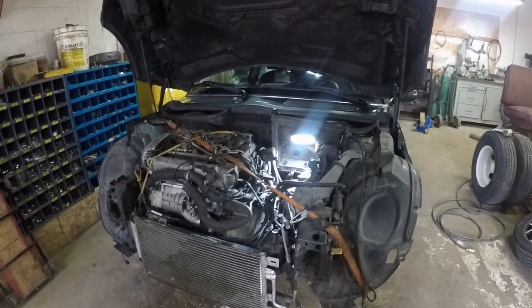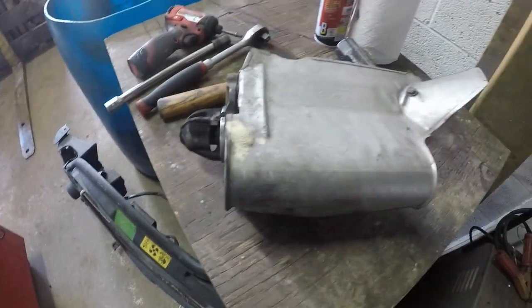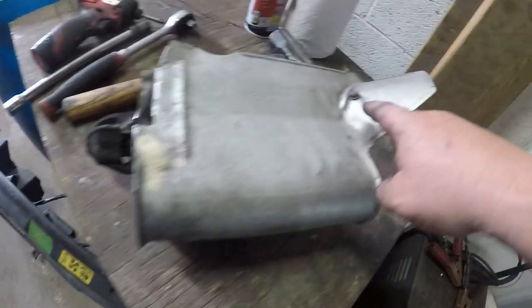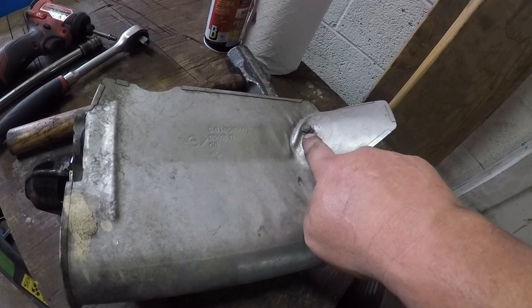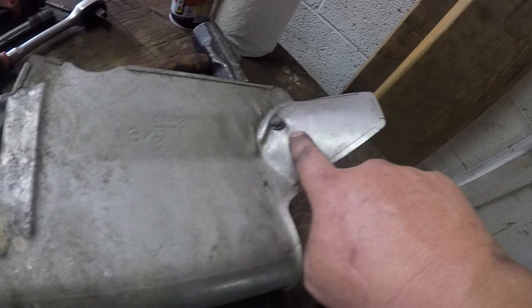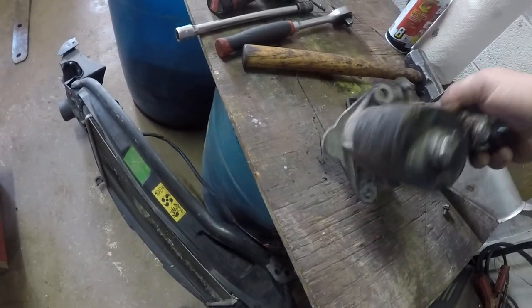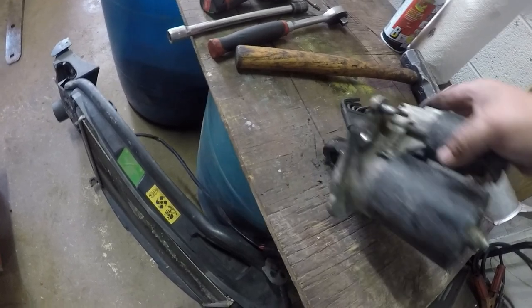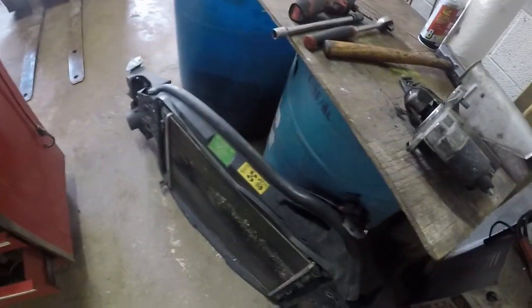Well, that was a hassle. The starter motor is held in by this heat shield — you have to take off the heat shield to take the starter motor out. The heat shield is held in place with one screw, the exhaust pipes run right over it, and that screw is very hard to see. You use a 10 millimeter wrench to get that screw out, then you can get the heat shield off and take the starter out. The upper bolt was also quite the opposite of fun — you can't even see it, you have to feel around for it.